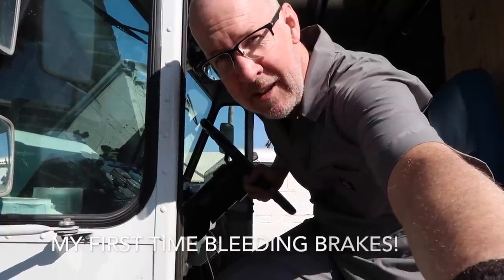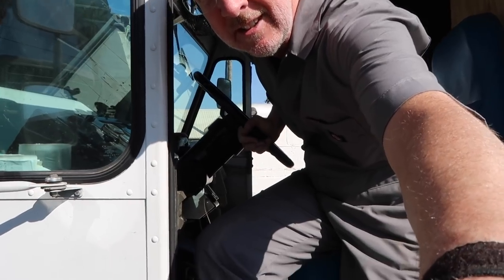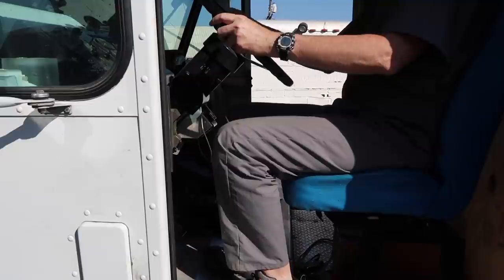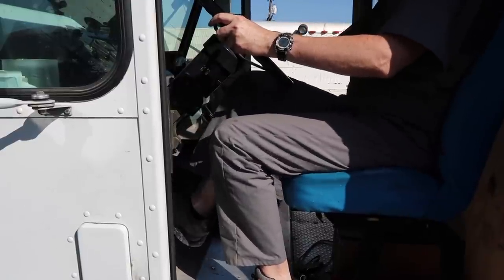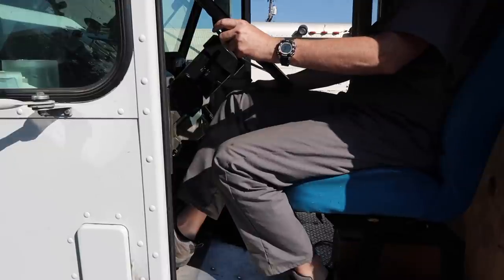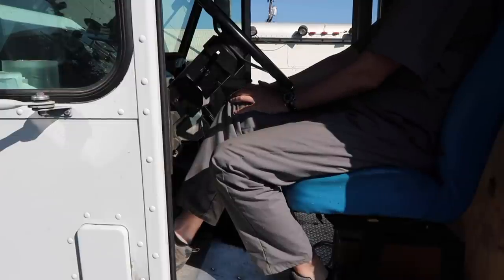Okay, we're gonna bleed the brakes here. I'm gonna be the guy on the pedal, and Paul is underneath giving me instructions. All right, Paul, I'm ready. All right, pump it. One, two, three, four. It's going down slowly. Down to the floor? No, it's maybe halfway there. You're still going down? Yeah, slowly. Okay, I think it stopped.